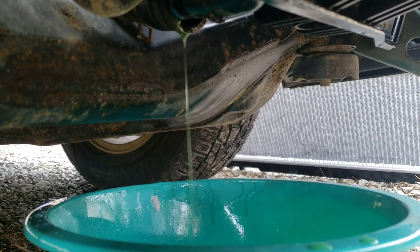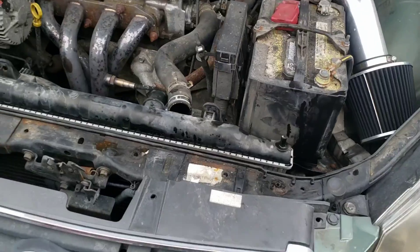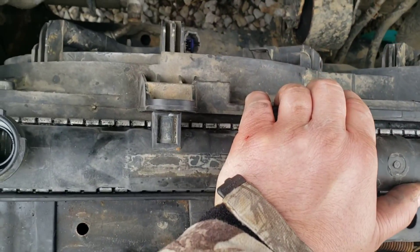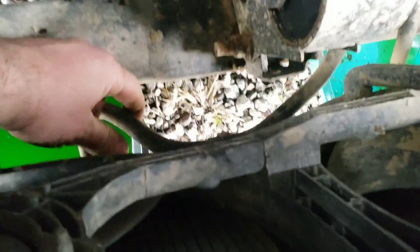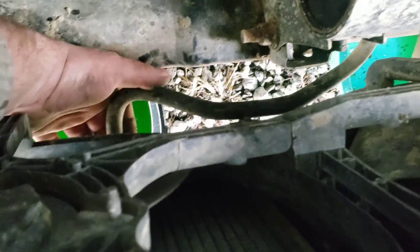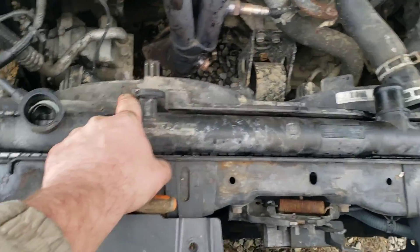I'm going to pop that bottom hose off. Even though the radiator stopped draining, a good bit came out of there, so be aware of that. I don't want to have to remove the battery and battery tray — this thing's attached to the battery tray, so leave this connected for now. Make sure it's unplugged. I've got to get those two other coolant hoses that we discussed down there out. There's a little clip there — pop that out. I'm not sure 100% if this is trans fluid or oil yet, but we'll find out. Once I have these two lines off, I can just pull the radiator with the fans out as a whole assembly, and then take the fans off after.